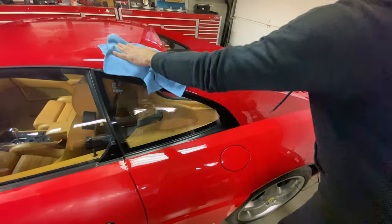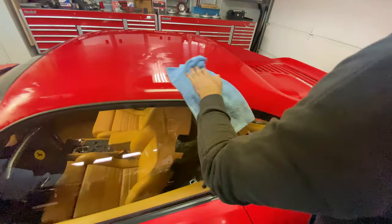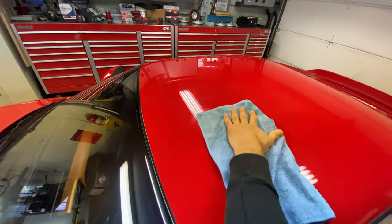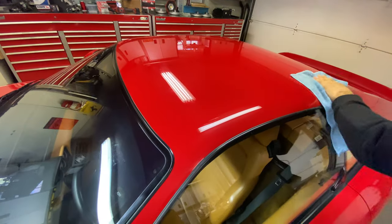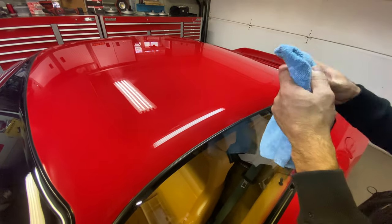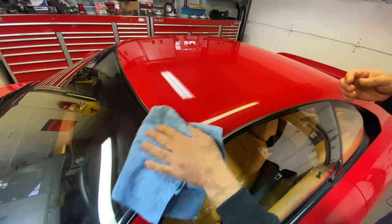That warm glow is the whole point — a lot of synthetic products today are not going to give you that warm glow on a red Ferrari with single-stage paint. I'm going to go over this with a Griot's Garage edgeless microfiber when done. I like to do sections — one half of the car at a time. The rear tailgate area will be the hardest part. The Zymol micro wipes don't have an aggressive enough tooth — but that's probably intentional since this is designed for single-stage paint, not modern clear coats.